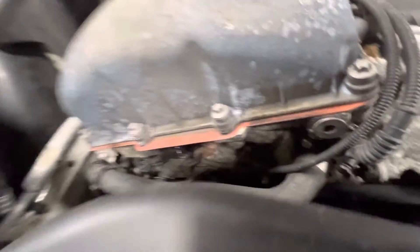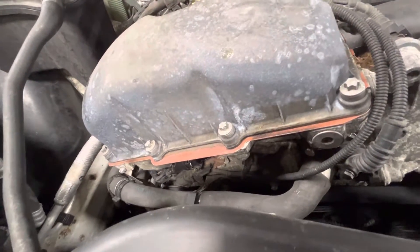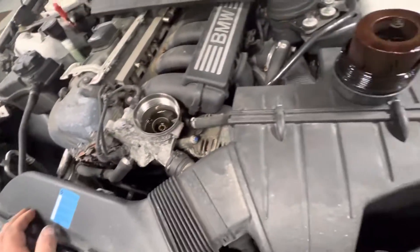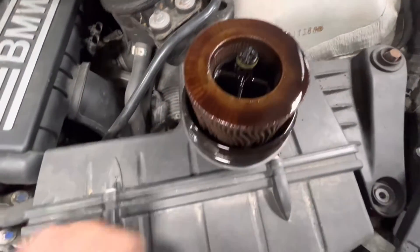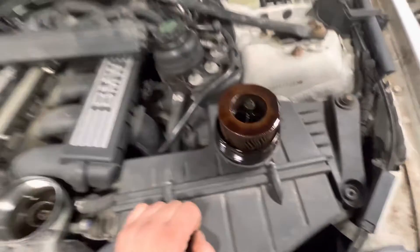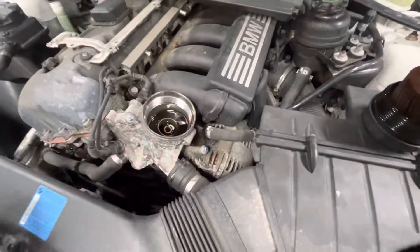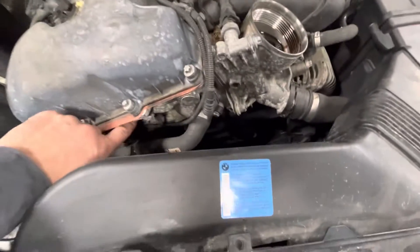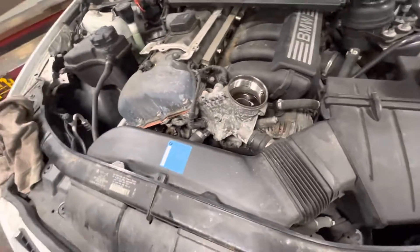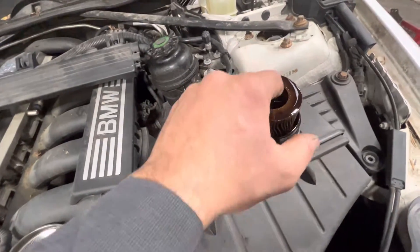If it lines up with an oil change — if the car was always fine, you never had a light on, just had the oil changed, and now all of a sudden the car is running funny and you have all these timing-related faults — best thing to do is pull your oil filter. You can do this all on the floor at your house. Pull the oil filter up and make sure they didn't leave out this center piece. I've seen it done many times at quickie-lube places — they'll be rushing, not familiar with these, and they'll leave this whole center piece out, just have the filter floating in there. That'll cause an oil pressure feed problem to the cam and to these adjustment solenoids, and you'll actually get a bunch of vanos faults that way too. So if it lines up with an oil change, just pull the filter up and make sure the center is not missing.